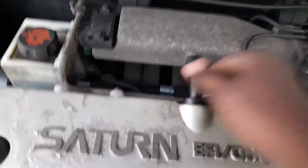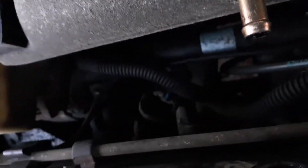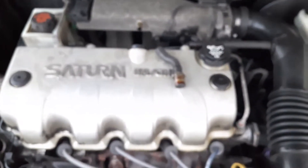It's real simple — just pull this hose off right here at the intake. You can hear the ball; you can't always tell just by looking at it that it's bad. The hose is kind of hard to get off — I might want to change this hose too. But you can tell it's sucking up a lot of oil because it's a lot heavier than the new one.